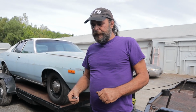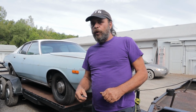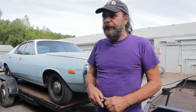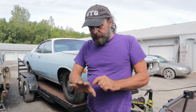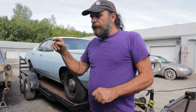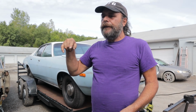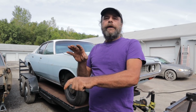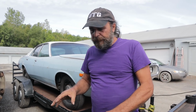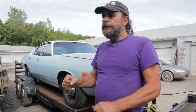I'm noticing that as I'm driving it, the clutch pedal keeps sinking lower and lower, right? Well, that's kind of weird. The tension feels good, the pedal feels good, but it's grabbing the gear lower and lower all the time. So there's no time to adjust this thing. So I pull around and clean the tires, revved it up, popped the clutch to clean the tires, and then when I hit the clutch again to come to a stop, the pedal was just on the floor. So I jammed it in first and just drove it back to the pits.